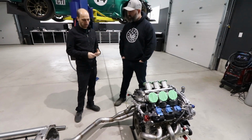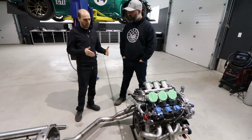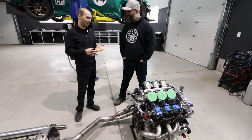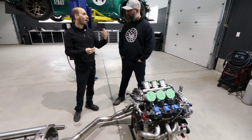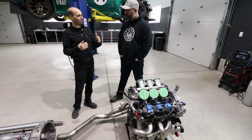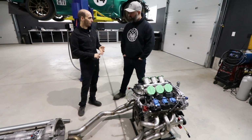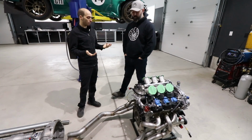And the idea is basically, if we're making the car hybrid, the Z is already a little bit overweight. Sure, she's a bit portly. So we're going to add probably 200 pounds in a hybrid system. We can't just put that 200 pounds on top of the car. The car's got to come down a bit, and then the 200 maybe becomes 150, 100. So if we can get rid of the starter, the clutch, most of the weight on the flywheel, the clutch pedal, the hydraulics, that's a good chunk of weight. That's at least 50 pounds.